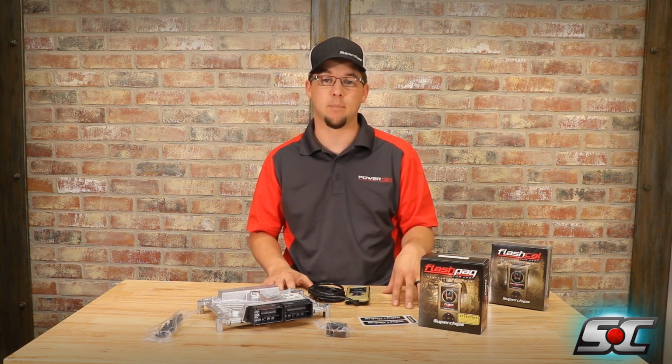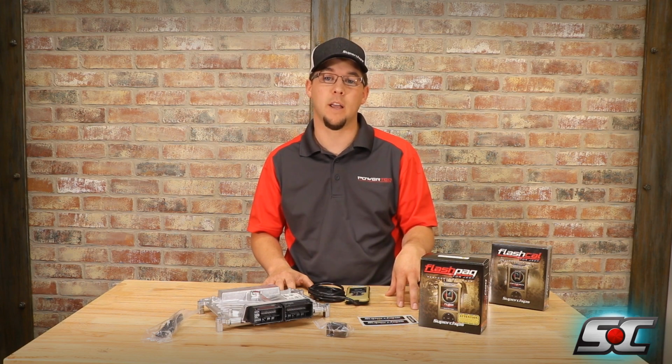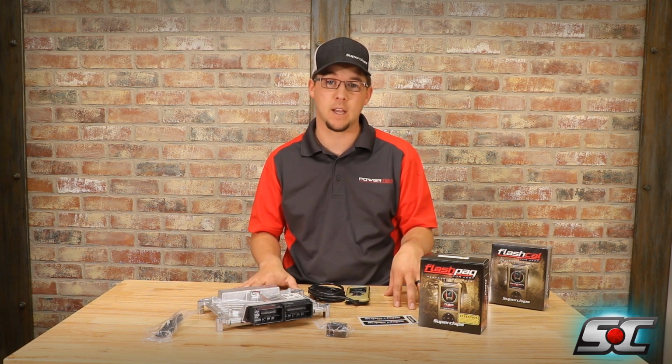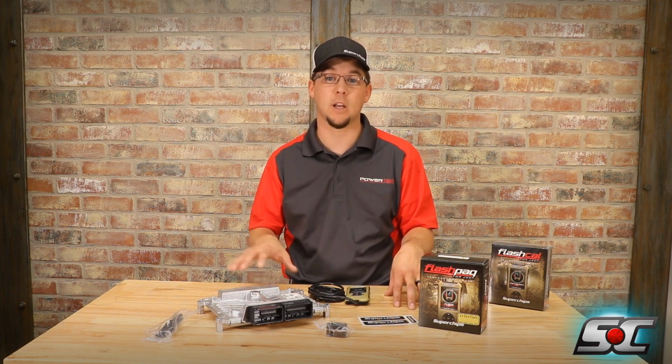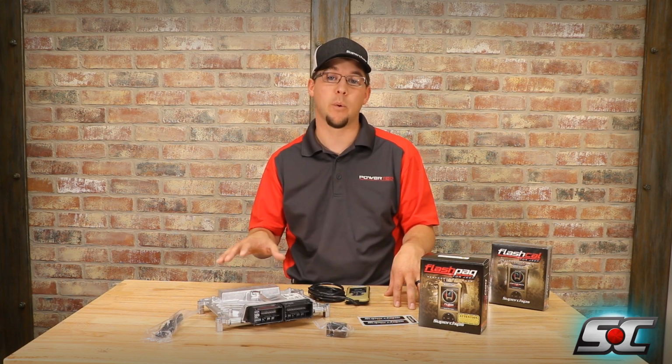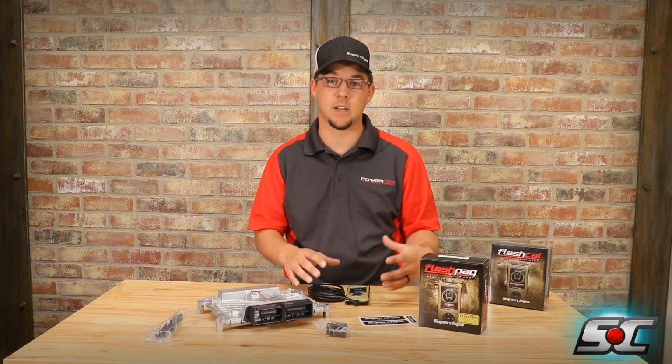In this specific application, we're picking up 20 horsepower and 25 foot-pounds of torque at peak. While that doesn't sound like much, we're not really focusing on the peak-to-peak pickups. We were able to drop the peak power, where this factory system makes its peak horsepower at, say, 4,900 RPM, to 4,600 RPM. The torque we were able to drop from 3,700 RPM to 3,300 RPM. So you feel that peak a lot sooner in the RPM range, which is nice for drivability.